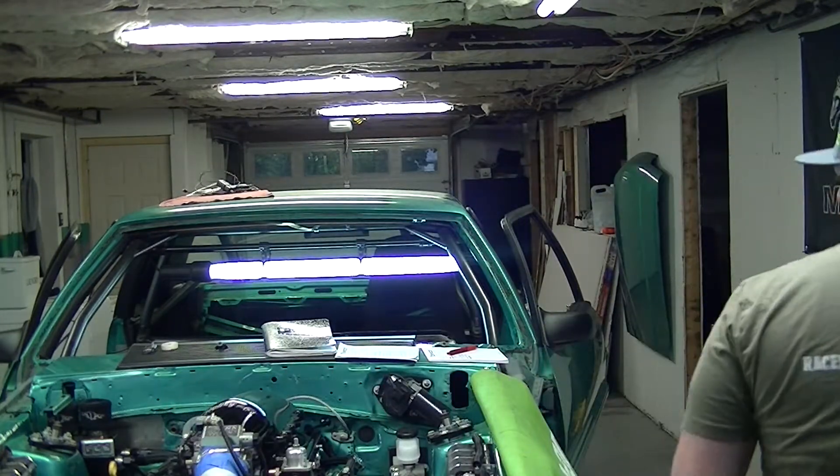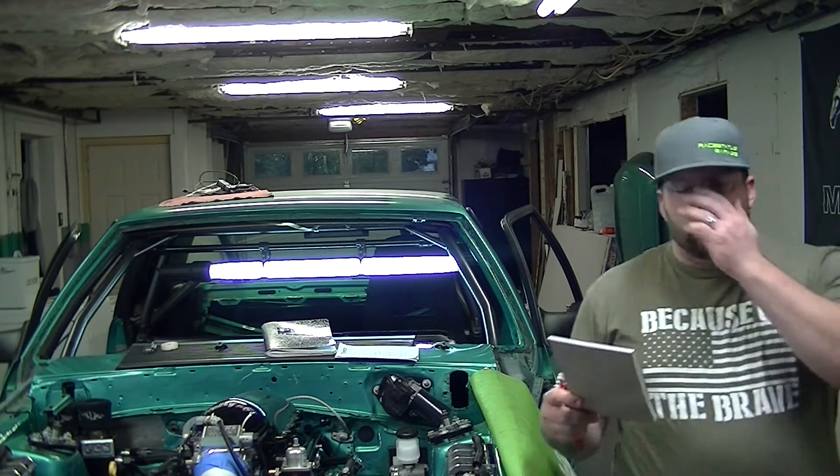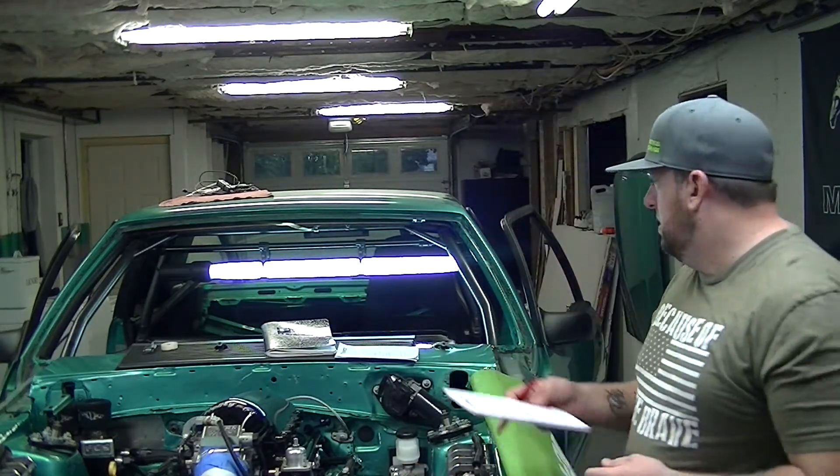I've been getting the wiring almost done and I'm almost ready to put the dashboard back in. I've got to run two wires for the wideband — it gets a clean ground in the ECU and the five-volt signal. I also need to put a ground on my wiper control box and run a wire to the back for the flex fuel sensor. I was all out of two-pin Deutsch terminals, so I ordered a bunch and they come in tomorrow.